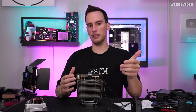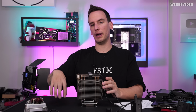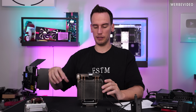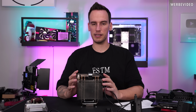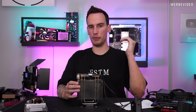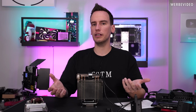The heat capacity is how much energy in joule or kilojoule you need to heat up a material of 1 kilogram by 1 degree Celsius or 1 Kelvin. And the heat capacity of this specific metal alloy is about 1/4 of water. So it can take only 1/4 of the energy to reach the same kind of temperature change. At the same time, the thermal conductivity is a lot higher. It's about 30 times higher than that of water.